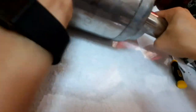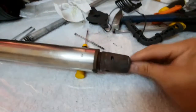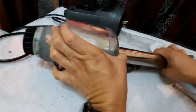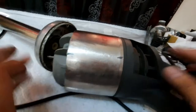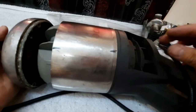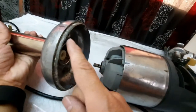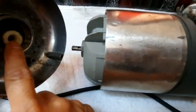Once you are sure everything is aligned, simply insert like this and then turn the wheel. Once you turn it, you see that the impeller or the blade is turning — that means it is cross-matched. Remember that there are two sockets for the speed controller; don't forget to fix them before closing. The reference is always to mark this screw here, so you can cross-match on the other screws, and this should always be aligned on the slot inside the drive shaft.